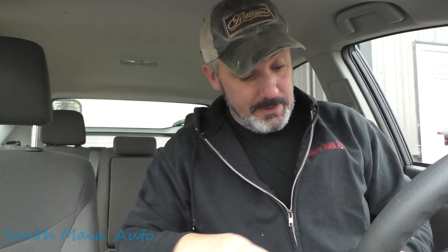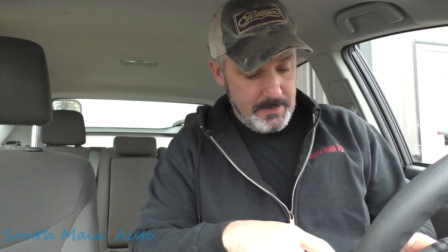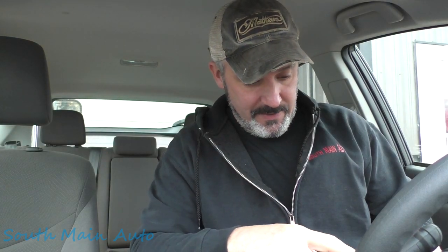They probably have two different issues, or at least that's what I told the lady, because usually the ABS traction light doesn't have anything to do with the mechanical brakes as far as noise, brakes grinding. So sometimes when people's lights come on, they get what I call hypersensitive. ABS light comes on and all of a sudden we hear all these things. So keep that in mind. I'll let this thing get loaded. We'll see if it's having an issue with a wheel speed sensor or something, perhaps.